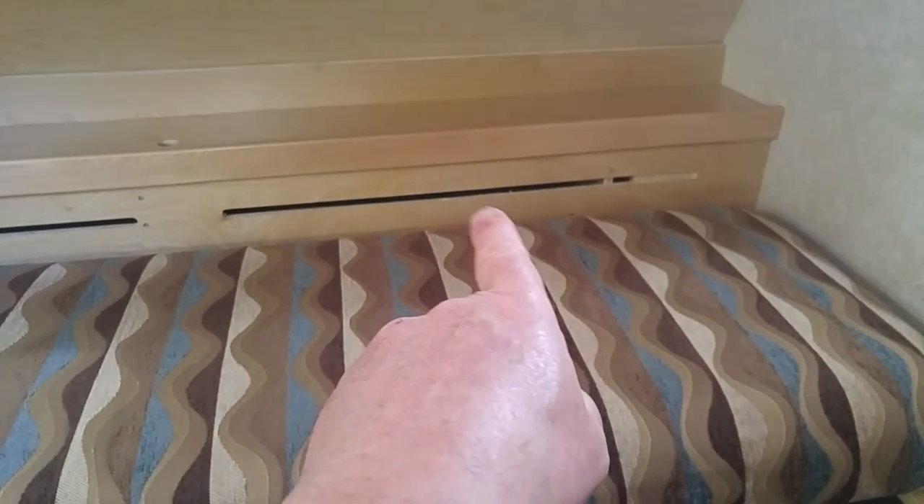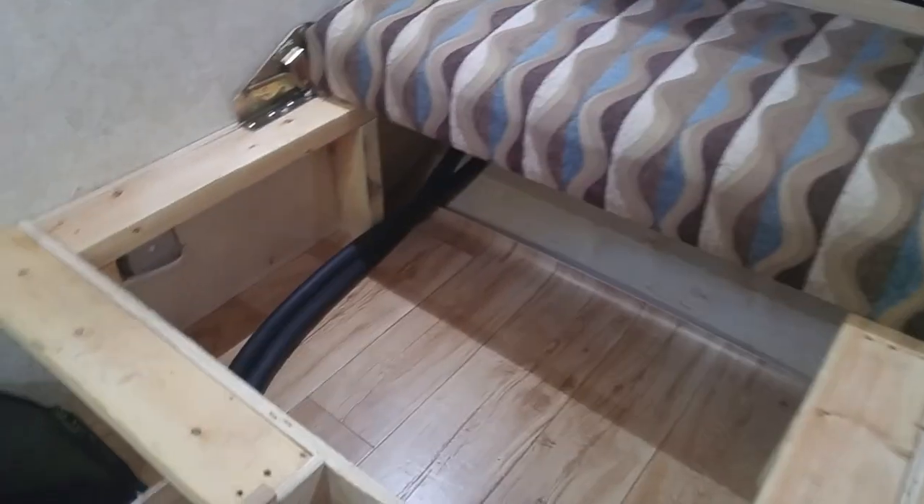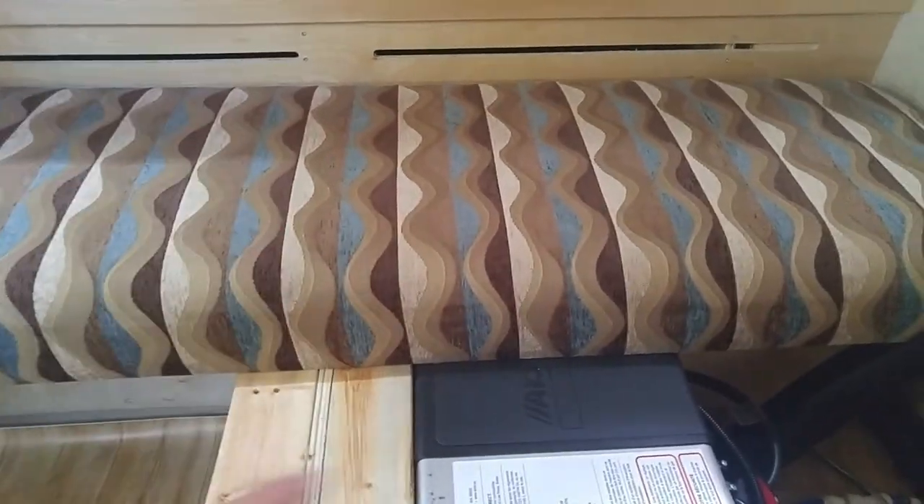When you drain with just the original drain, you might get this radiator out, you might get most of that radiator out, but this one stays full — probably half your liquid is still sitting in the system. That's why they have these complex pump systems to try to get that liquid to go, and I'm going to skip all that.